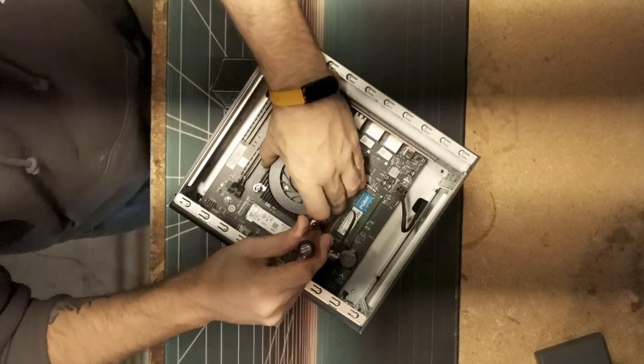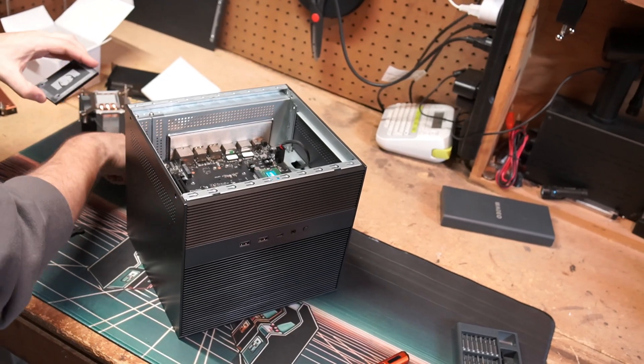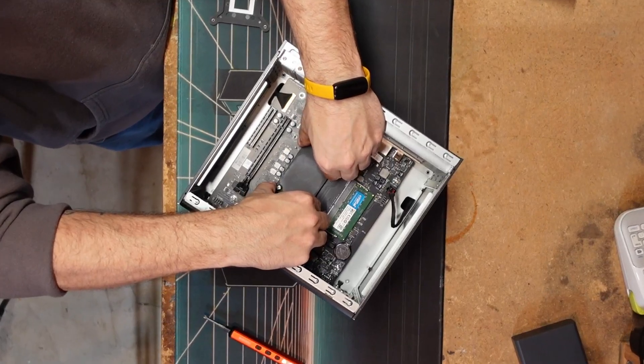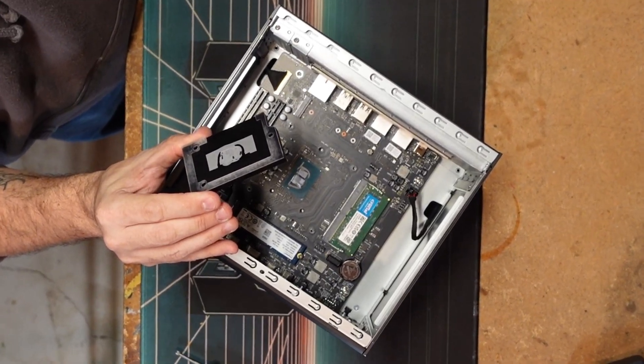All in, these upgrades bring the base Zima Cube closer to the creator edition price point, at least on paper. Now let's talk about the actual process for upgrading that stock CPU cooler. When you take off the stock cooler, there's a small rectangular metal plate that's actually touching the CPU die. The chip itself is soldered to the board, so there's no replacing it with a socketed CPU like I was hoping. You need to remove that metal cover because it directly touches the chip die underneath — be careful wiggling it back and forth. It had thermal paste pretty caked on there.